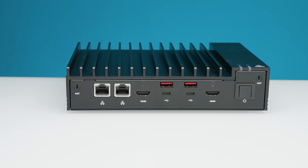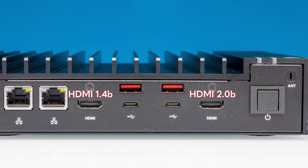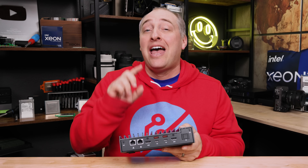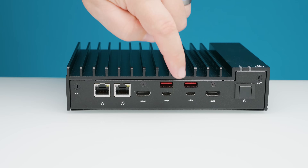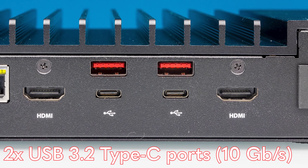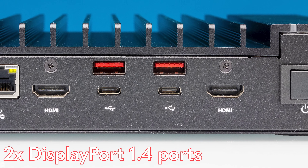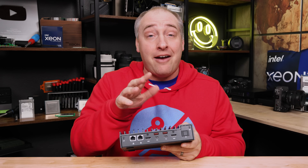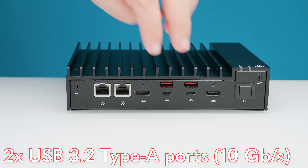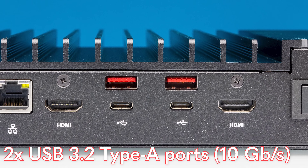In the back of the system, we get two HDMI ports. One is an HDMI 2.0B port and the other is a 1.4B port. You can drive displays out of this thing, and it doesn't just stop there - we also have two USB 3.2 Gen 2 10 gigabit per second ports that can run in DisplayPort output modes. Using DisplayPort 1.4 Alt mode, you can have a total of four displays out of this little box. Aside from those two USB-C ports, we also have two USB Type-A ports, also USB 3.2 Gen 2 at 10 gigabit per second.